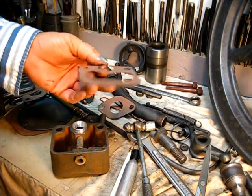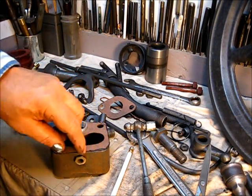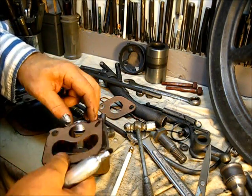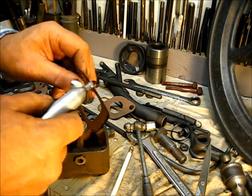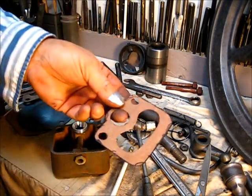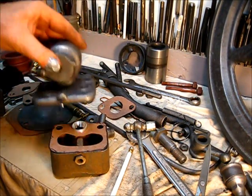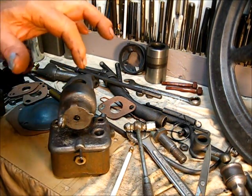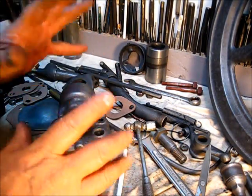Well, not quite. What I done is I did not want to see this gasket peeking out when I got done. So what I've done is I took this felt pen — it's a good quality one with permanent ink that won't wash away — and I went all the way around the edge of that three or four times and let that ink soak into the edge of the gasket. That way when you put that thing together and bolt it down, you won't see your gasket, no matter what color it started life as.